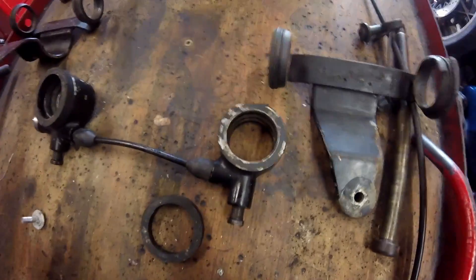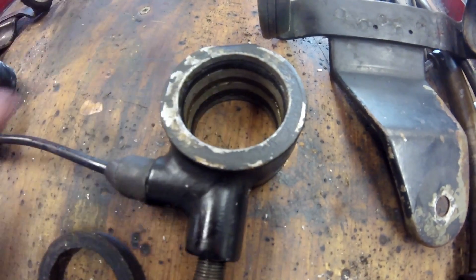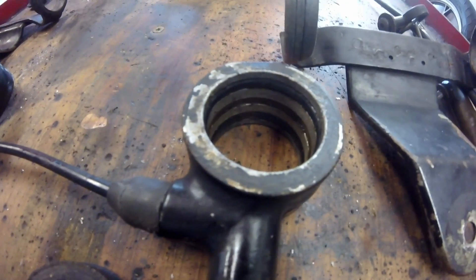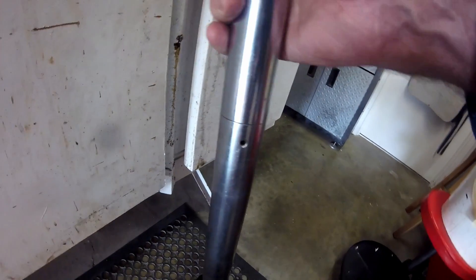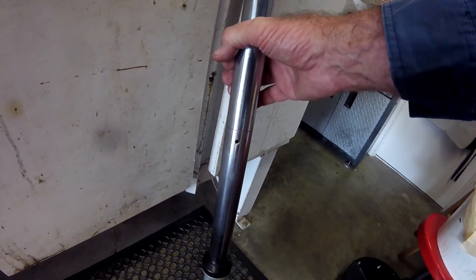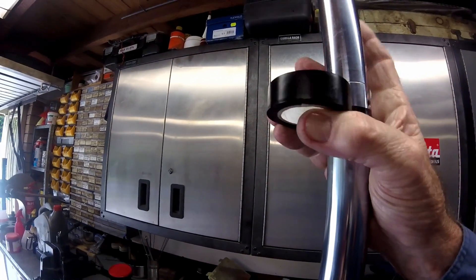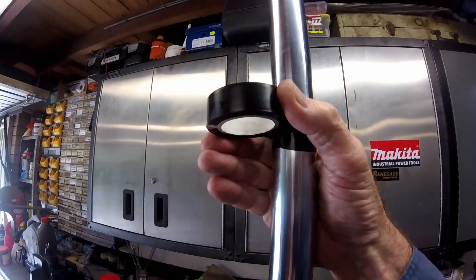The manifolds for the air pressurization of the street bike forks contain O-rings at the top and bottom, and you need to check their condition and replace if necessary. Even if you do not pressurize your forks, these need to be in good shape to prevent oil leaking out. The fork tubes also have an opening which these manifolds surround. To replace the fork oil without it leaking out during reassembly, you will need to block these holes — here Bob is wrapping PVC tape around the opening area to seal it off.